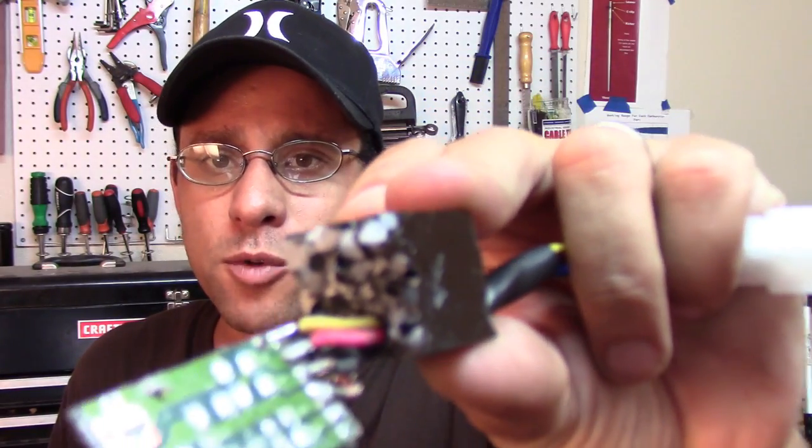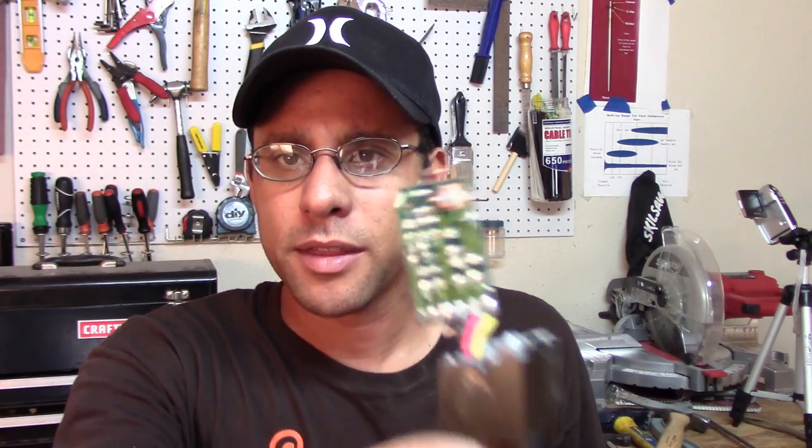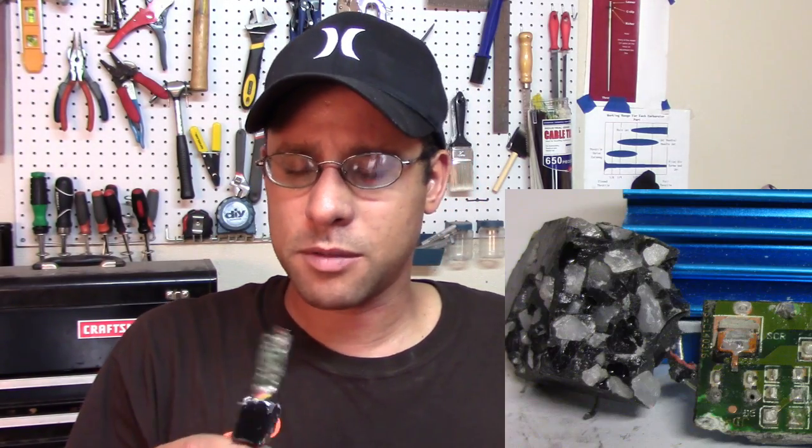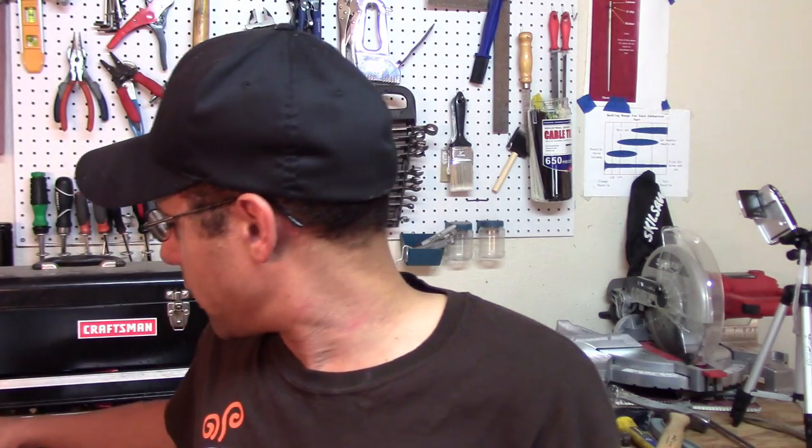For the second blue CDI that I cut open, I got some good results. I actually did find some gravel inside — I'll post some pictures so you can get a better view. I was able to get the circuit board out and it does have the same board, but as I said, we do have gravel. It looks like they used gravel as a filler so they don't have to use as much of that hard plastic that everybody else is using.